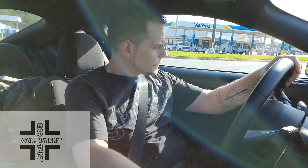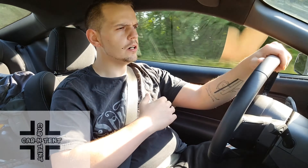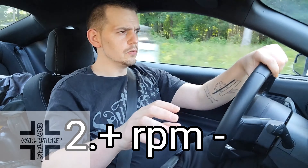You should still do it. Letting a car warm up just lets everything get ready. If somebody startles you awake and you have to get out and run a marathon, your body's not going to react well. It's kind of the same with a car. You should let your oil pressure settle, because these cars have an accelerated warm-up process. On a cold start, your car fires up and goes to a higher RPM for a few seconds — that's to warm up the catalytic converters. But the last thing a cold car needs is high RPMs. So you're trying to let the oils flow, all the fluids start to lubricate everything before there's any more stress on them. Let your cars warm up — be kind to them and they'll be kind to you.